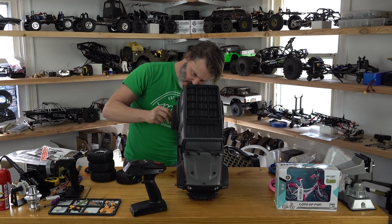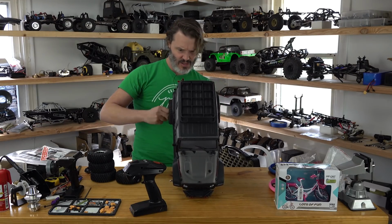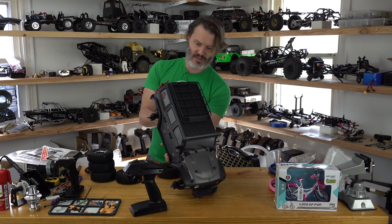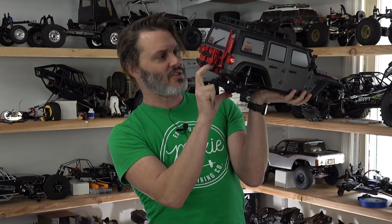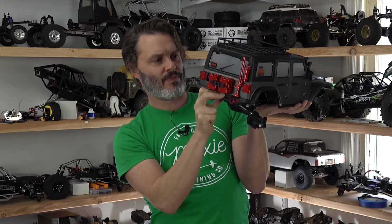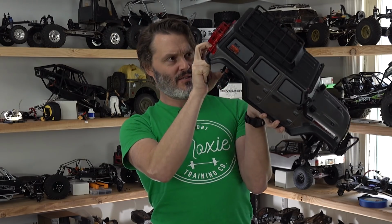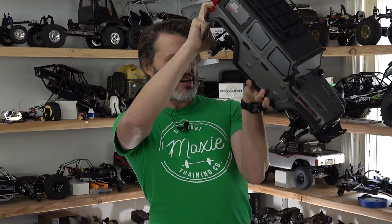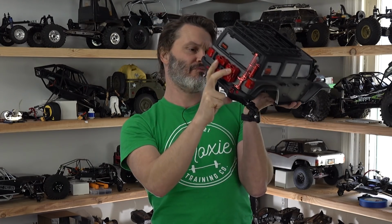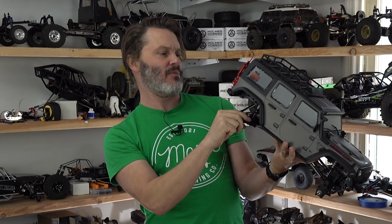TGH-HO wheels. All right, so the 3-link looks like 3. Why do they have that on the back? So we have a 4-link, but then we also have this bar on the back. That's an interesting choice. Why would they do that? I'm not quite sure why they would have a 3-link on a 4-link. There's really no reason for it, unless there's not enough triangulation, but their lowers are double triangulated, so that's an interesting choice, I'll say. I'll probably end up removing that to see what's up.